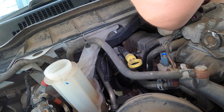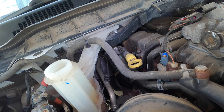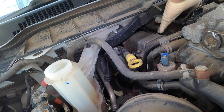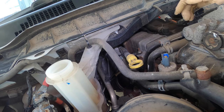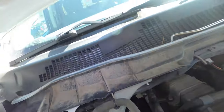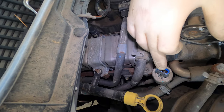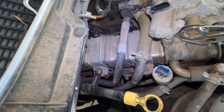These Chrysler connectors with the red lock tabs are not my favorite. We'll go ahead and get all this wiring out of the way. Make sure you keep track of the weather pack and the pin lock - you can see it stayed in the exhaust back pressure sensor. As long as you know where it is, that's all that matters, so when you're messing with it you don't jostle it around and have it fall out.